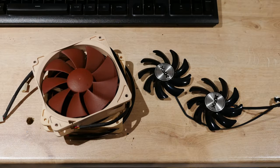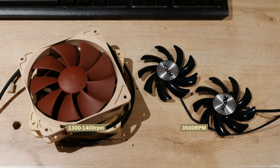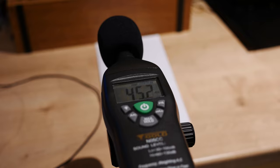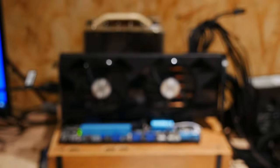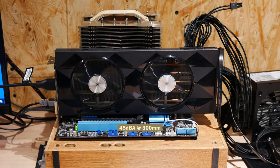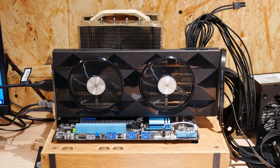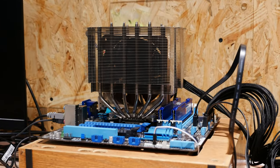Now this is going to get a bit technical. These fans go up to 1400 RPM, but the XFX ones can ramp up to 3500. Temperature comparisons become biased when you can brute force your way through, so we need to set their speeds on a common baseline, which would be noise. So I bought this sound meter, and at a distance of 300mm in front of the card, they're all set at 45 dBA — just shy above a whisper.